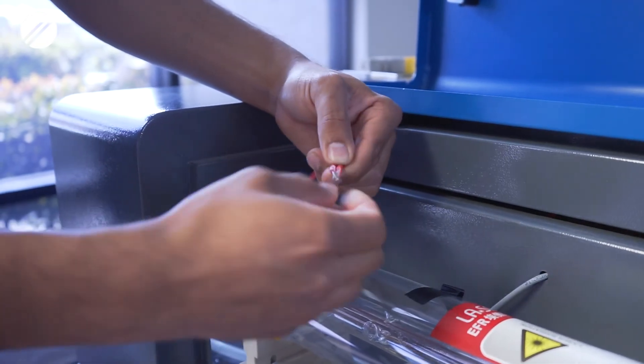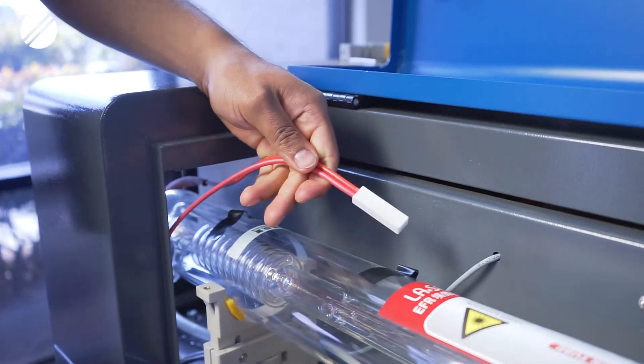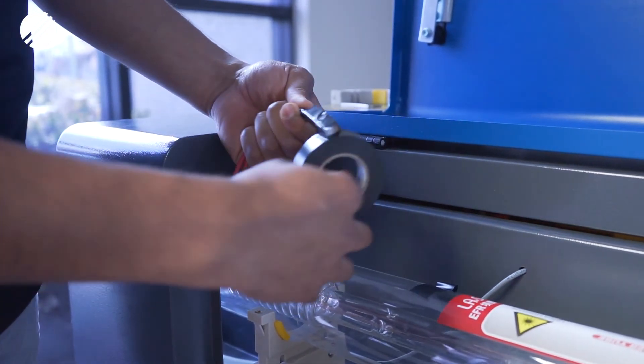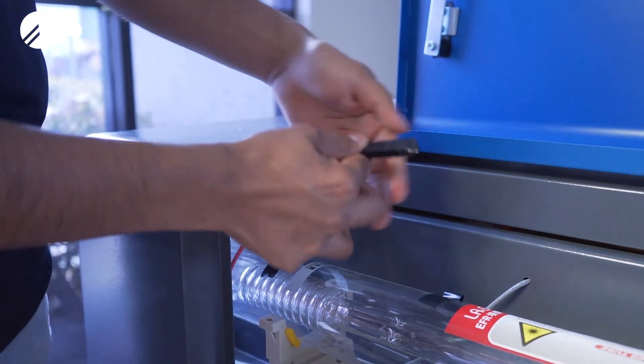For the red power connection, you would want to trim some of the red cabling on the wire so that when you insert the white ceramic block, it will be easier to insert the cables all the way in. After you do that, you would then wrap the ceramic block starting about half an inch from the power cables themselves with electrical tape, to prevent arcing issues.